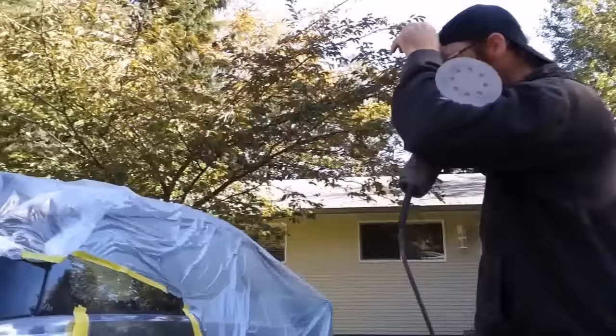No, you've got to block everything. I roughed it out. The first stage, you use a machine for, just because you're not particularly concerned with getting it totally smooth. But if you use the machine the whole way, you're apt to cut down a lot of areas that need filler, and it doesn't do as good a job. So you're better off blocking it. I see. From this stage on, some people will use machines, but.